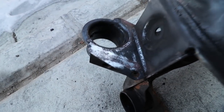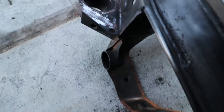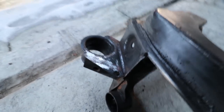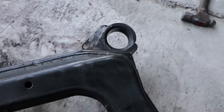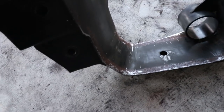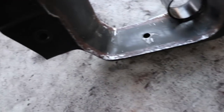This thing is doing a pretty good job — a lot of that rust is gone. It's just a long, slow process and there's a lot to do on here. I really don't need to get every single speck of dust off because the paint I'm going to be using is a rust-inhibiting paint, so as long as we have the majority of the flaky stuff off we're going to be golden. Basically all the places that had really thick rust — even down inside — I sanded that all off so it's not crusty with big height and depth changes from the rust.